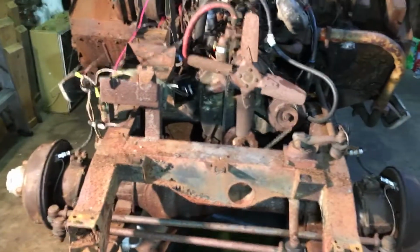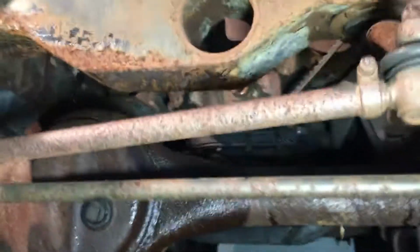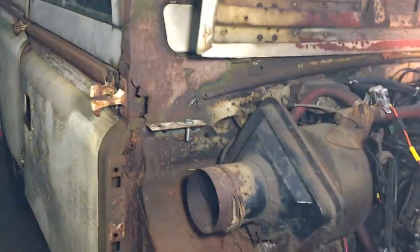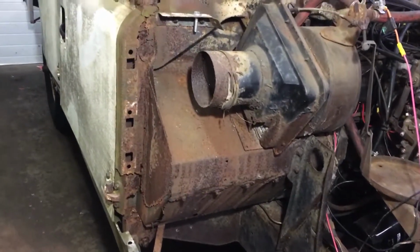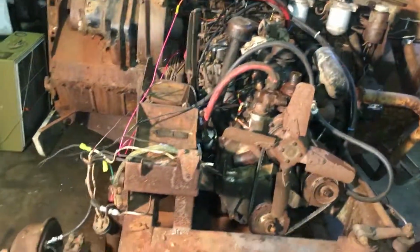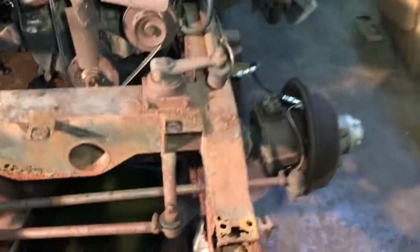And now for the rust repair, it's going to be what they call the dumb irons down on the end. This crossmember, which is pretty crusty down underneath, and over to here to the bulkhead. Going to be fixing, get new buckets, footwell buckets and door pillar and everything, and welding all that in. Also plan on making a new wiring harness for the headlights, the horns and everything.